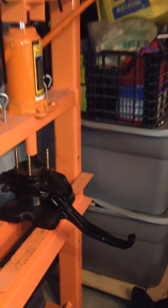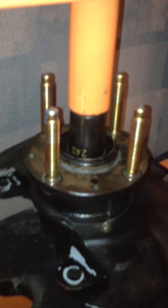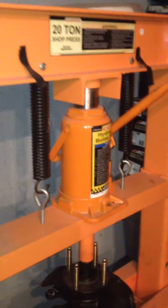In this video I'm going to show you how to press in the hub into the knuckle. Here I've installed ARPX wheel studs on my Honda Civic Del Sol wheel hub assembly. There's the knuckle, the studs, and the hub already pressed in. We press it in using a Mackgo 24 millimeter half inch drive impact socket pressing onto the hub with my Harbor Freight press.